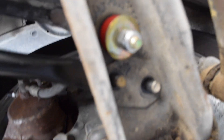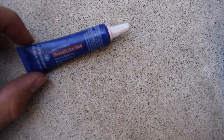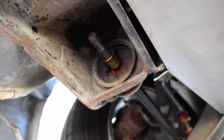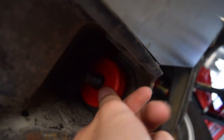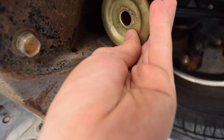As you can see, those are in. With suspension parts, I always put thread locker on — this is the red thread locker, but it comes in blue bottles; it's high strength. You can get removable, but I like high strength because I'm not going to be replacing this anytime soon and I don't want it coming off. I don't know the exact torque specs for this — if you know them, drop them below and I'll put them in the comments. Now take this piece, stick it on there, then we have two washers — the thick one and then the small one. Put those on, and we're ready to put nuts on all three bolts.